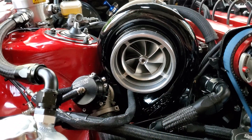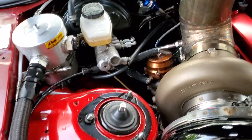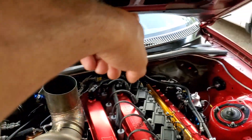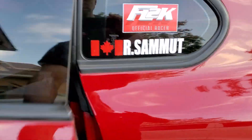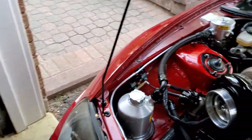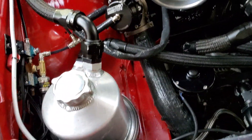You can tell it's Gen 2 because it has seven blades - a Gen 1 has six blades. It's got twin Precision Gates 46 millimeter wastegates. The new setup we added this year is CO2 boost control - there's a CO2 bottle inside. The Gates are going to be controlled by CO2, which lets you pretty much pin them shut so you can make as much boost as you want.